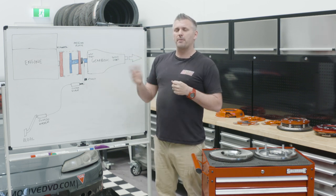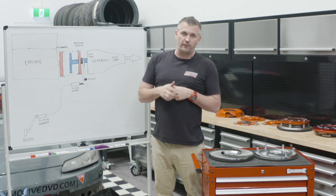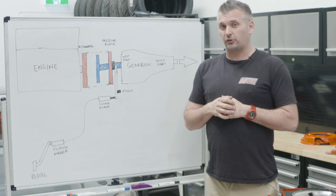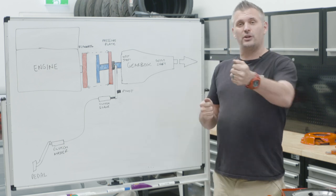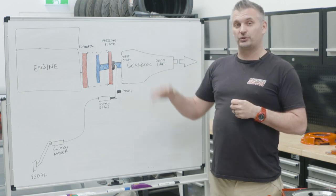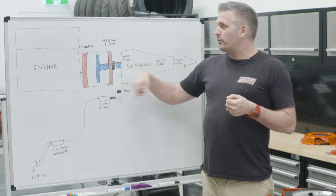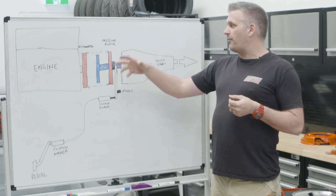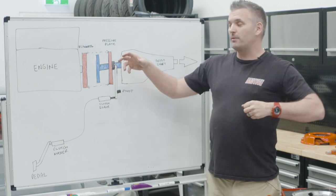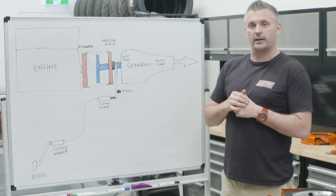If you've ever seen a car with a mega-light flywheel and you give it a free rev, the revs go up very quickly but they also come down very quickly — kind of like on a motorbike. In a race car with dog engagement, that doesn't really matter so much, but in a street car that can actually be bad, because when you go to change gears, you put your foot on the clutch and the revs actually drop too much — you'll find the car will then grab again and be jerky to drive. The reason why we want inertia in that flywheel and pressure plate is so that when you take off, you get a smoother engagement, because it's able to counteract the inertia of the drivetrain and the car itself.